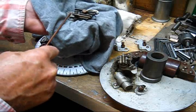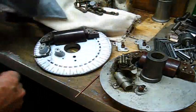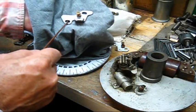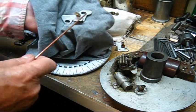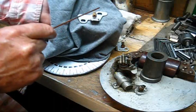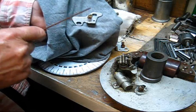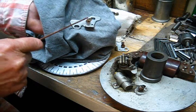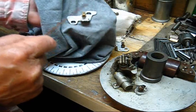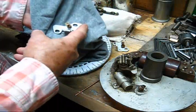These two holes here are in exact position — you need to remember that. You should have already observed that. In order to see it better, we might look at this backing plate and this oval shape here — that's identical on all the points. Another position which is the same and does not vary at all is this fixed pin right here. That is the same on all of the points. You only have to be careful that your governor arm doesn't hit that.